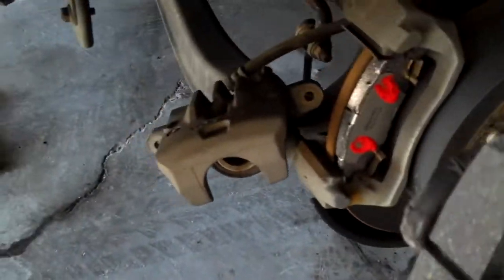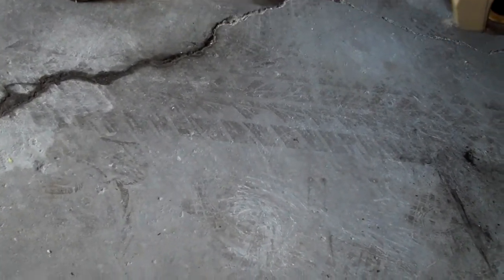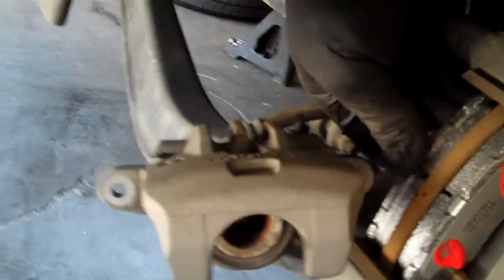Some require a little bit of lube on the ends here. When it comes to making your brakes be quiet, I use this brake quiet. You can either glue them — which I'm doing using a very lightweight silicone glue — or you can lubricate them; one or the other. It's good to do one or the other. Some have lubrication in between the little extra pads that you buy, depending on how fancy the pads are that you get.